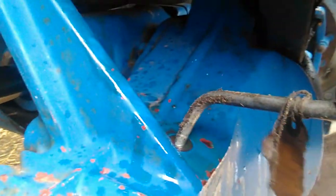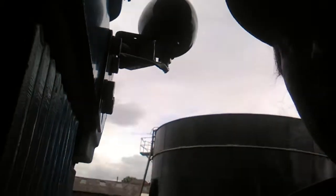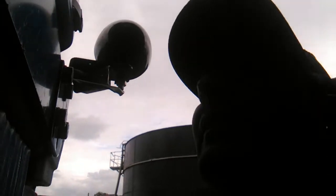On the top of the axle you've got the breather — as you can see it's made a bit of a mess, there's been a bit of a collection issue. The problem was it only just fits in, and of course it pressurizes the axle up and spurts oil everywhere. Used a piece of stiff wire to dip and check it against the other side — she's done now.